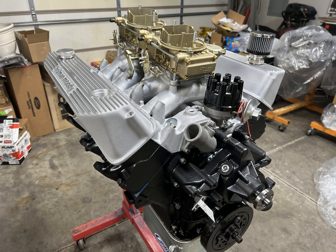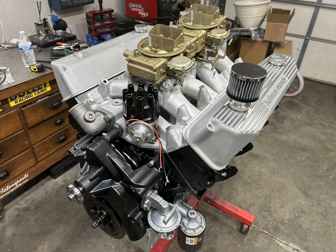Starting to look like an engine — we've got a factory-style distributor with a Pertronix conversion locked out for this application, Blue Thunder Holman-Moody valve covers, a factory-style water pump, and a pair of 715 CFM carburetors from Drew Pujetnik down in Georgia. Air, fuel, spark — and those carburetors didn't need anything after we bolted them on. We didn't touch a screw on the dyno; air/fuel ratio was perfect, mixture screws were perfect, balance line between both carburetors worked great with no issues on the secondaries opening.